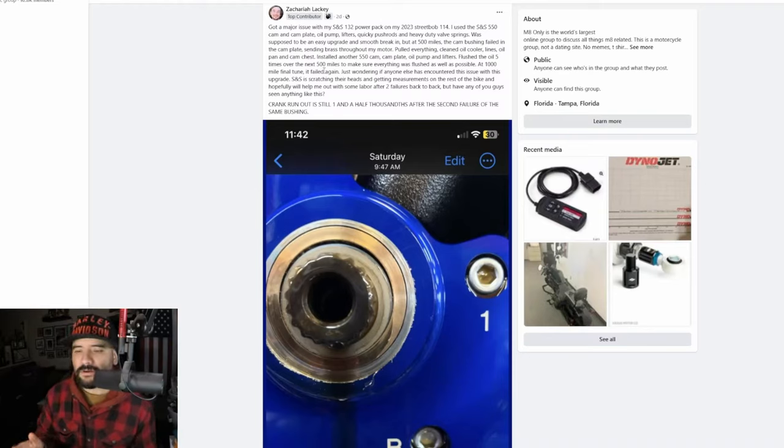I have seen brand new Harleys with low miles, we're talking, I think, 800 miles, with 10 thousandths of runout, guys. Or was it 9 thousandths? It's a high amount. So technically, due to Harley Davidson's tolerance and the softer alloy that they're using in their cam plates, because like I said, they're no longer using the brass bushing, that's given them some tolerance and some leeway to have these high crank runouts, which is causing this issue.